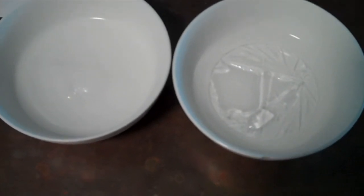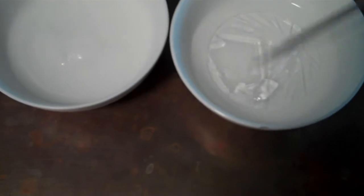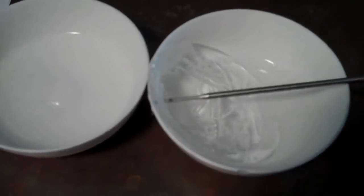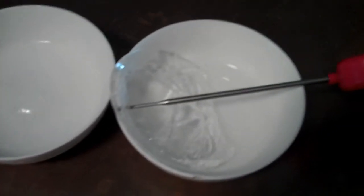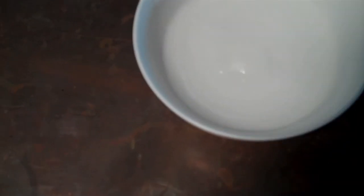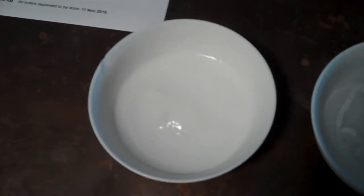After three hours in my DIY thermoelectric cooler, there is ice in there but it's not completely frozen — about half the water is still liquid. In the compressor unit after three hours, using less energy, it is completely solid with no bubbles visible inside. The compressor unit completely froze the contents in three hours.